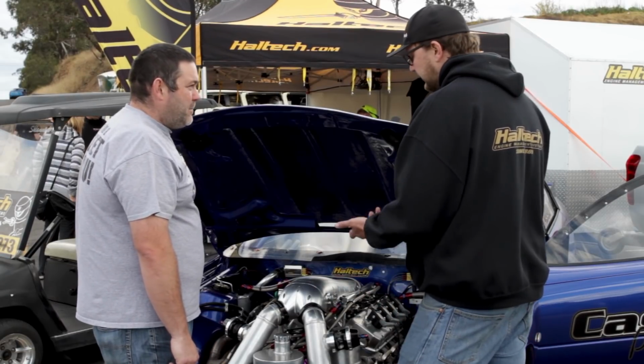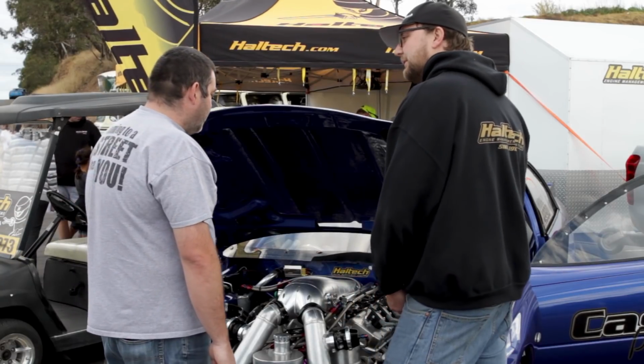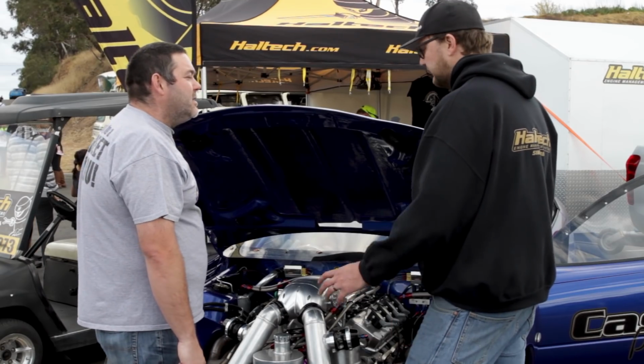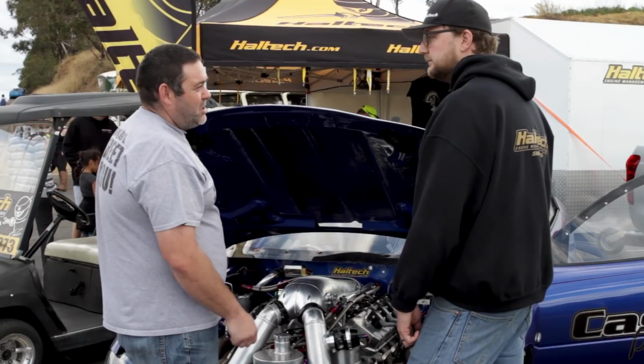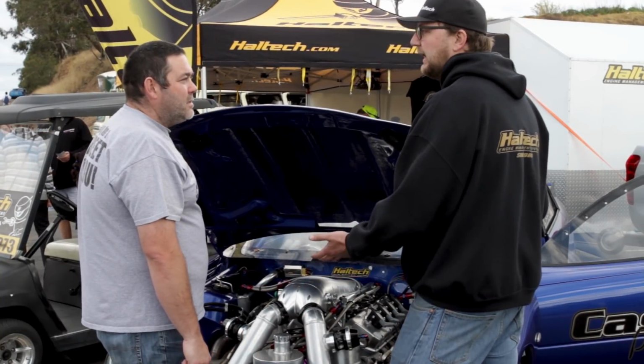Right, okay. And then when you start getting high, let's say you target 50 pounds of dome pressure, what would you see in the intake manifold? 40 to 42, somewhere around there. For sure. So as your back pressure goes up on your exhaust manifolds, you need to put more dome pressure on there to get the desired boost. And that's something you figure out as you're tuning the car. Yep.